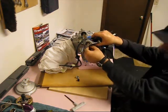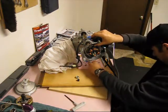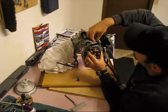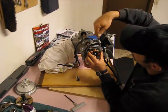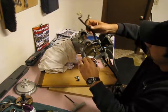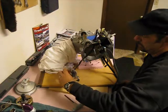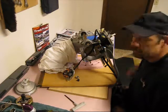There are two five millimeter bolts — one up here and one down here — that hold the stator in place. We'll take those out and set the stator aside. There's a rubber grommet right here on the wiring harness that fits into the crankcase half around the wire to create a seal. I've slid that down to give some extra room as we pull the stator out. I'll just leave it connected and give it enough slack to set the stator out of the way while we separate the two crankcase halves.